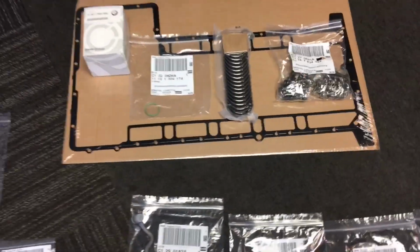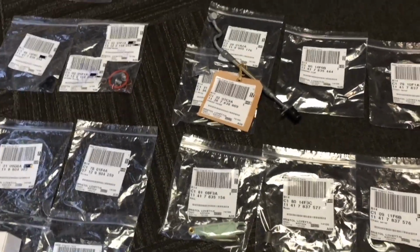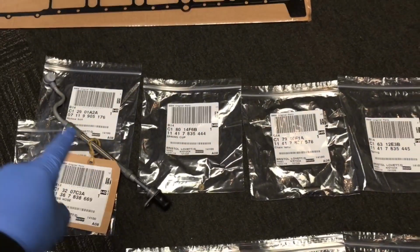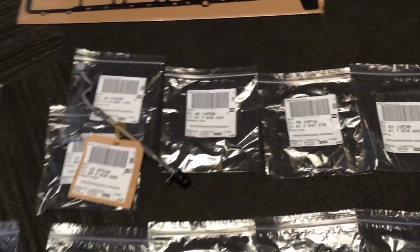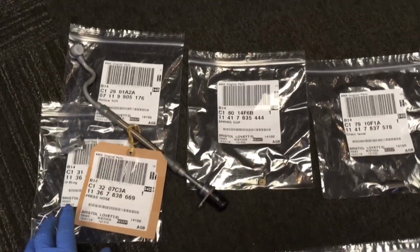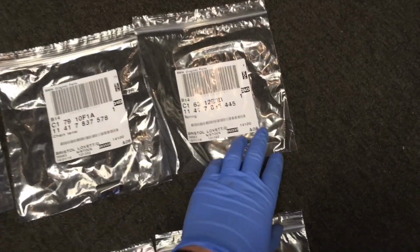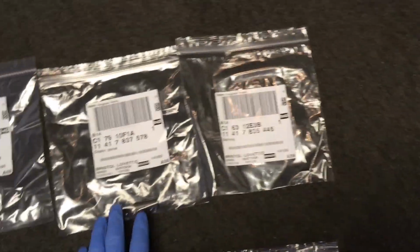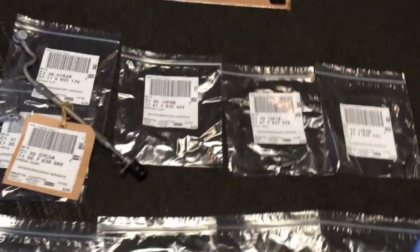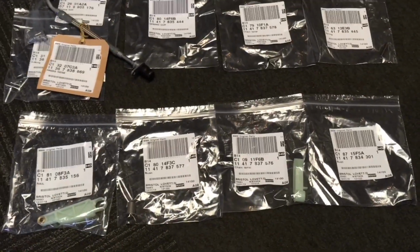And then from there you've got other options, and this customer is going quite detailed, having nearly all the things done that you could do, nearly. So it's having the Vanos high pressure pipe, the internal pipe, plus the banjo bolt and the top O-ring. And then we've got spare chain tensioner items, so it's the spring, the sleeve and the little disc which the spring sits in.